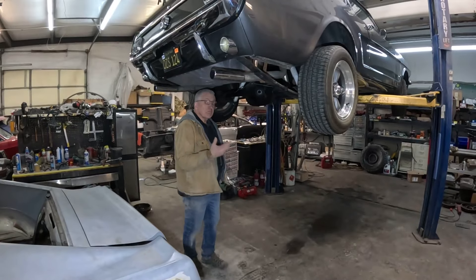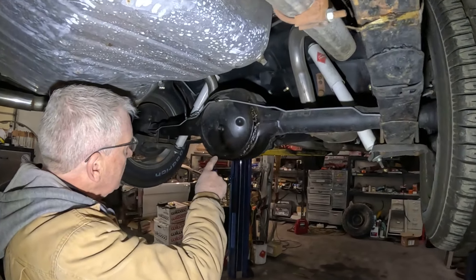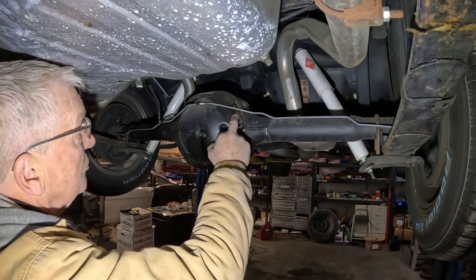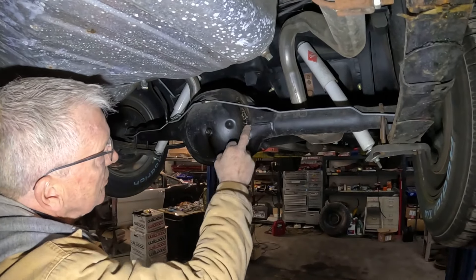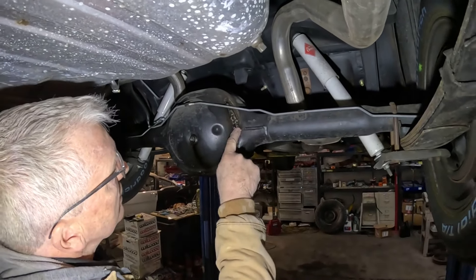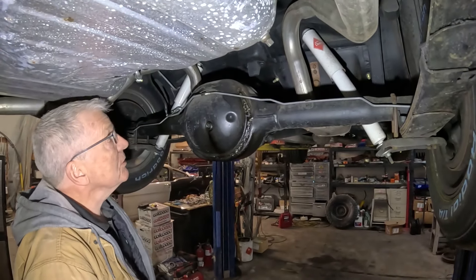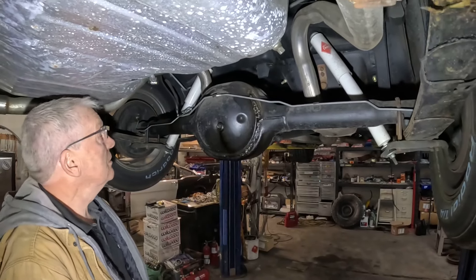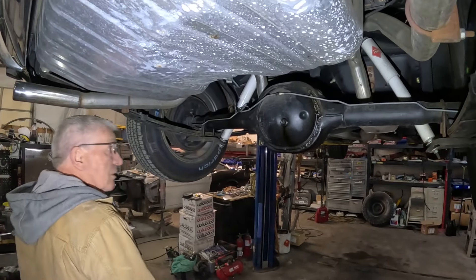Okay, so we've got the Mustang up on the rack — let's check it out and see what's going on. That's interesting — we've got an oil leak here. It looks like someone tried to lay some weld down around here; it looks like it has a leak around the seam, which I haven't seen before. That is not factory weld — someone added that on with a welder that didn't have anywhere near enough power for what they were trying to do. It's quite wet, so that's something we'll need to look into. Underneath-wise it's all looking pretty good; the floors appear fairly original, so that's not a concern.